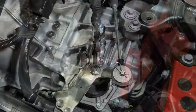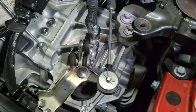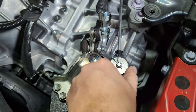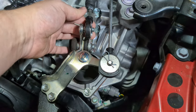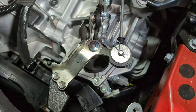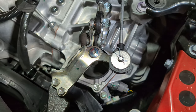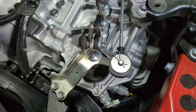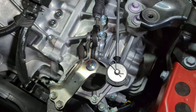I installed the new spherical bearings from Racer X, but I kind of don't understand the purpose when you have a spherical bearing and then cover it up with a washer — now there's almost no rotation in either one. There's a little bit, but it's not substantial. It almost feels like there should be a spacer between the washer and the actual bearing so it can rotate, because this just defeats the purpose. I don't know how I feel about this, especially with the cost being more than double the six element kit.